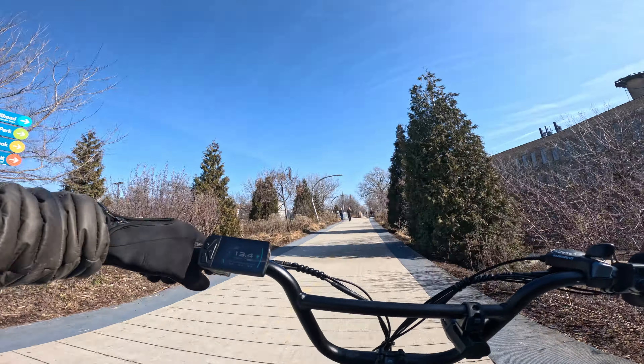Now with both batteries giving 40 amps and rear-wheel drive, it does feel like it has more power, and we actually make it to the top — just not very fast. Switching to front-wheel drive with 40 amps, the front tire spins out due to weight distribution and mud. Then with all-wheel drive and both batteries going, it just launched immediately up the hill.